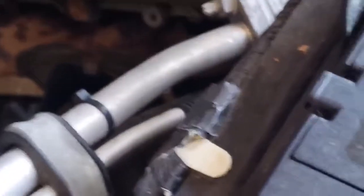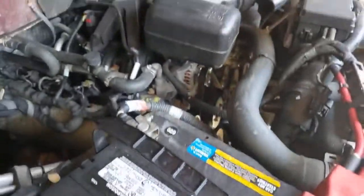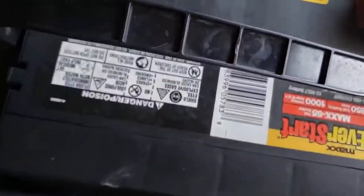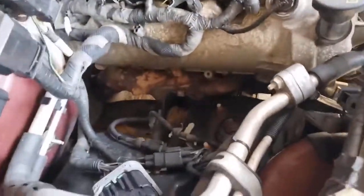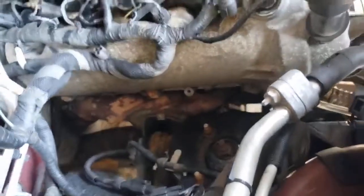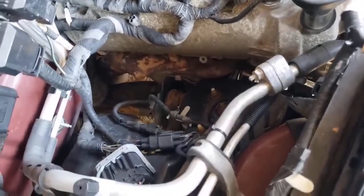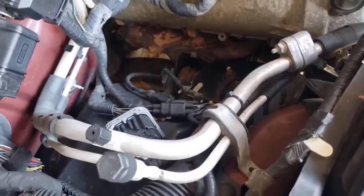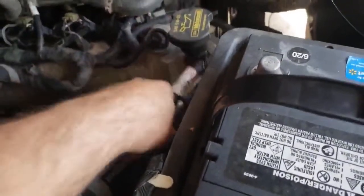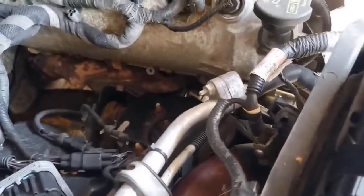This manifold was put on about five years ago, but this truck's in pretty good shape. The engine seems to have a lot of power. I had to put in an alternator and a battery — it's about a thousand amp, a big one. I have to take the starter off. At the Y-pipe I pre-sprayed the bolts — that's what the smell was when it started. It's got some PB Blaster on everything. The first thing to do is get on jack stands, take the wheel off, take the inner fender out. And disconnect the battery — make sure the cable can't come in contact. I might wrap some tape around it.